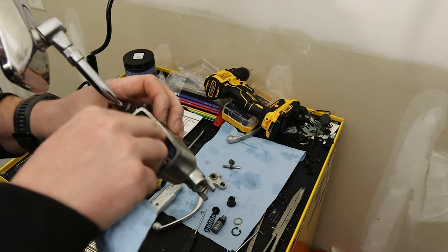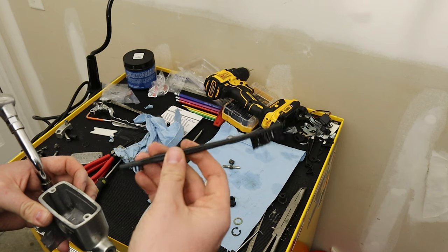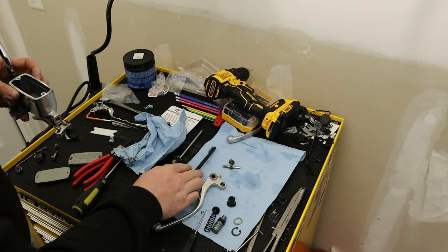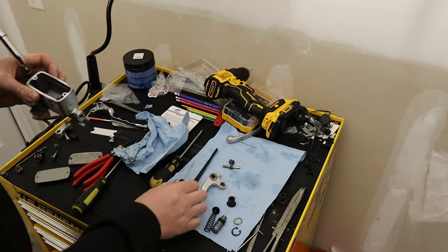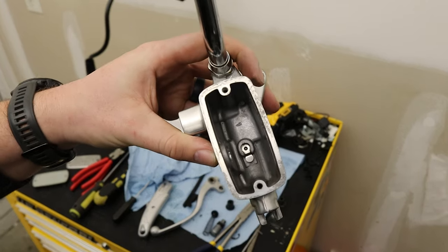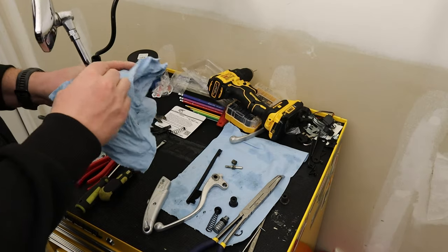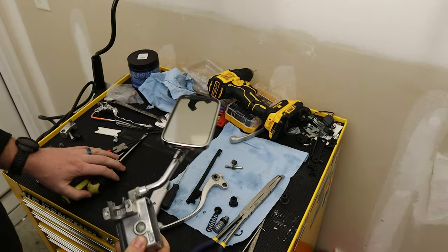I use a little pick tool to loosen it up and then wash it out with brake cleaner, or get in there with a blue paper towel. One thing I would say is you don't want to be too abrasive cleaning these — don't go in there with mad powerful Dremel brushes. A little bit of brushing is fine. I found this brush in the shop — I think it's originally for cleaning guns, but it's very useful for cleaning these things. Gun cleaning kits: great for cleaning these kinds of things. I'll come back when this is fully clean and we'll reassemble.